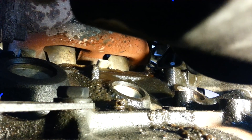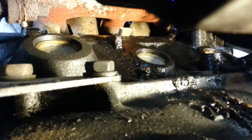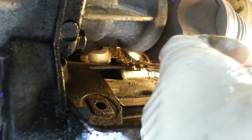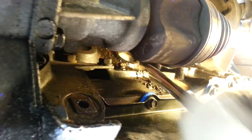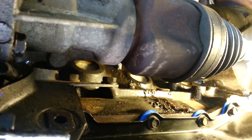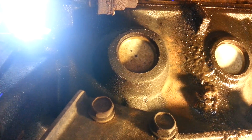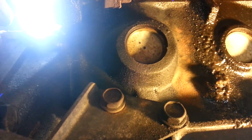It's got some oil hanging on it because it's a Dodge and they leak. The freeze plug is in the center approximately, and the drain plug - all crusty with oil - is at about the 7 o'clock position. The plug should be easy to get to with a 6 inch extension. That's above the axle shaft on the transmission, right above the midpoint of the block. It's a pretty straight shot.